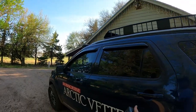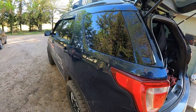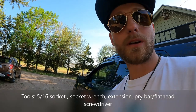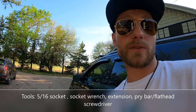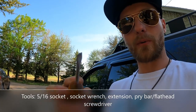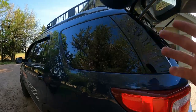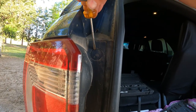Go ahead and use that promo code and get yourselves some LED reverse lights for your 2016–2018 Ford Explorer 5th Gen. These will be LEDs brighter than you've ever seen. Once you have those in hand, let's go over the tools real quick. You'll need a socket with an adapter because it can be a little tight. The last thing you need is some kind of pry bar — a flathead screwdriver will work, but a body panel removal kit would be perfect. Use your prying tool to get right back in here, and this begins the first step of removal.